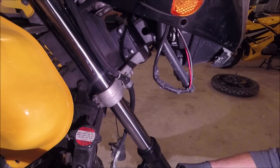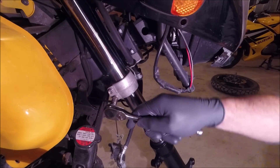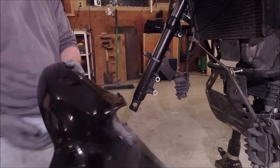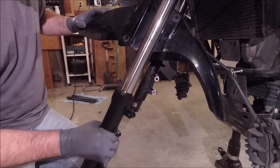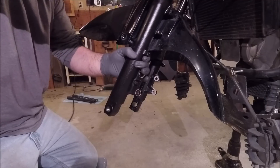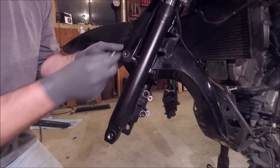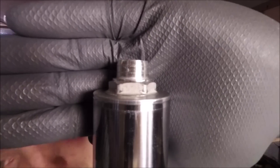Make sure that you've got your wrench handy and just tighten these down temporarily. We've got one of them on. Now we're going to put our fender back on and slide the other fork up in there. Temporarily tighten the pinch bolt and hold it there, then we can connect the other side of the fender.